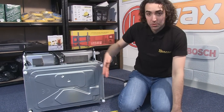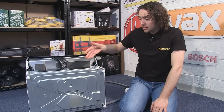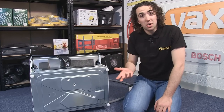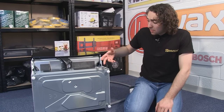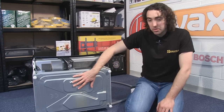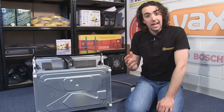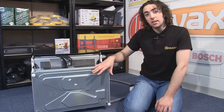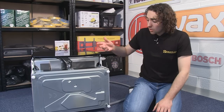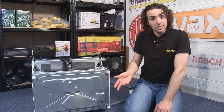Okay so now I've removed the four screws, the base plate should be able to just be lifted off. Now it's very important when you do take the base plate off not to press too hard on any of the metal edges because they're very sharp and you can cut yourself very easily on them. And the other thing to bear in mind is that virtually all dishwashers have an anti-flood sensor on the bottom of the base plate and this is both screwed on and attached with electrical connections. You'll need to remove that sensor in order to fully remove the base plate. You can either unscrew the sensor or you can take a photo of the electrical connections to remind yourself of what they are and then remove those instead.